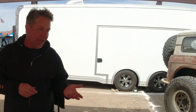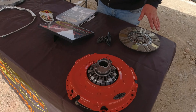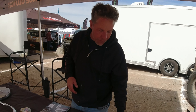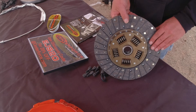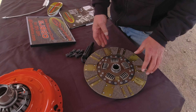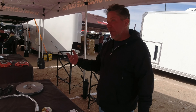In terms of the clutch assembly, we had to do a lot of tweaking. We have both a Center Force 2 or a dual friction — this is the dual friction example. It's a full-face disc on the front and then this puck-style disc on the back. What this does is it increases holding capacity. This is a little more aggressive clutch, so this would be the one if you're running really big tires or you've put a supercharger or turbo on the motor.